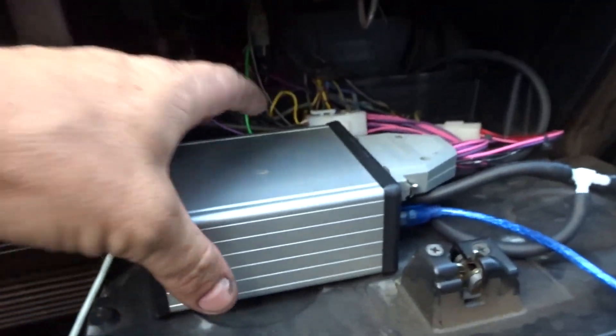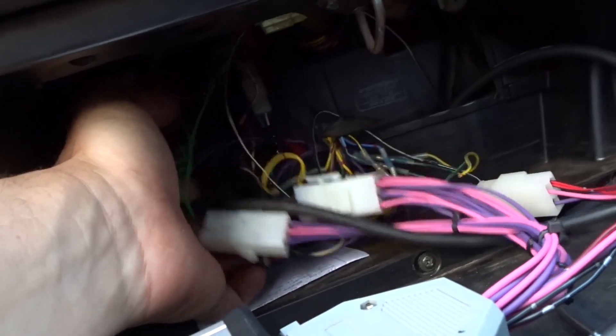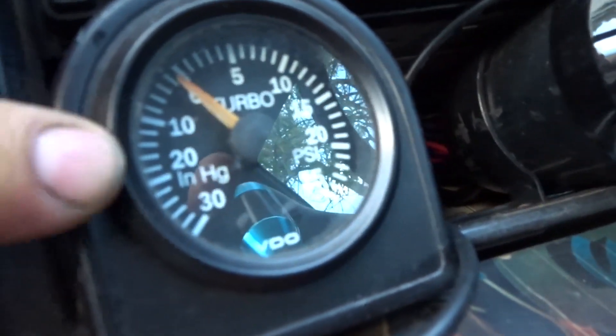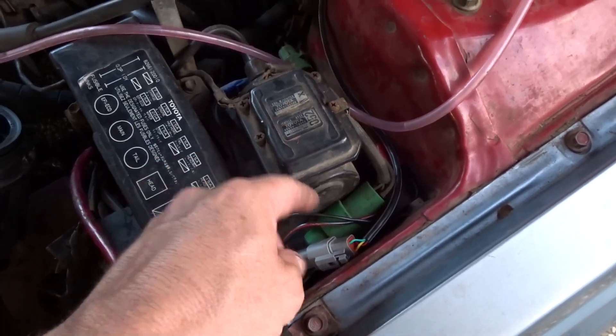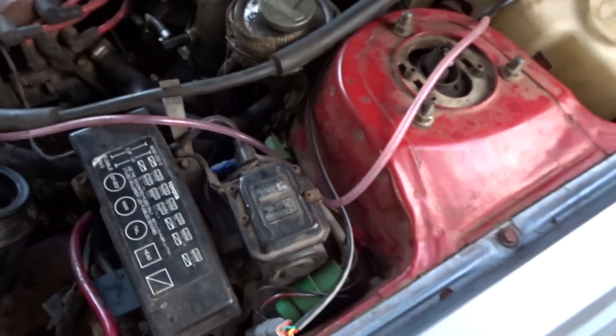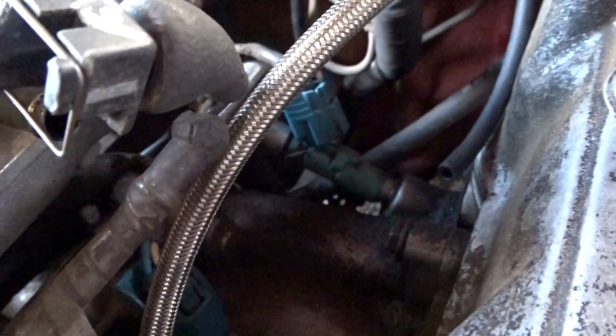I'll sprinkle in little details as we go but here's the ECU. It's running on a Speeduino which I've been pretty impressed with. Made a little patch loom to go to the standard wiring harness. We've got the map sensor hose teed off to the boost gauge, and we've got the air/fuel. Still running factory ignition but the wiring was a bit crusty so I've put a better connector in there and got some nice shielded cable. Try and get rid of all the spikes. In there you can see we've got some ST215 Caldina 3SGTE injectors - 540cc. Runs very nice.